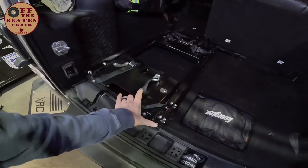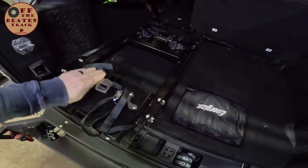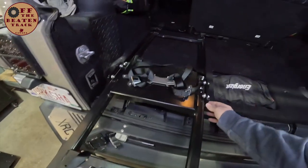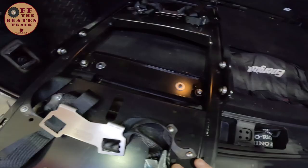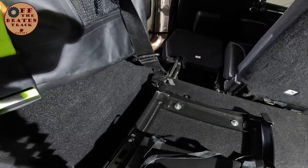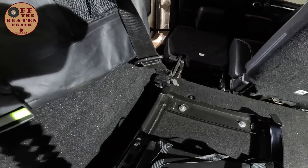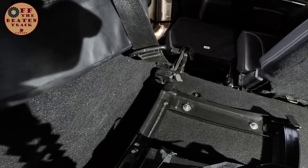When you use it with a soft top you've got to roll the soft top up a little bit to slide the fridge out. It's perfect with a hard top; a soft top is a little more difficult because you've got to unzip it and roll the sides up. I anchored this down in four places as the normal mounting instructions say — two bolts at the rear, two bolts at the front — straight into the base I made. I also installed the ARB power accessory, which goes straight onto the base and runs under the carpet up to the front into the battery.